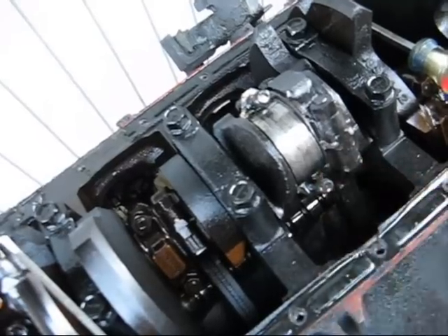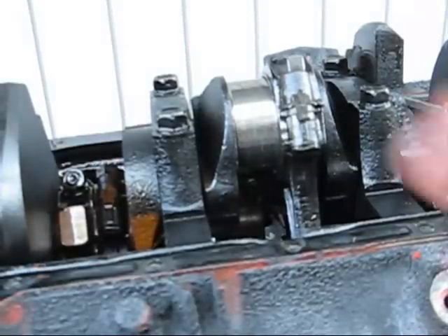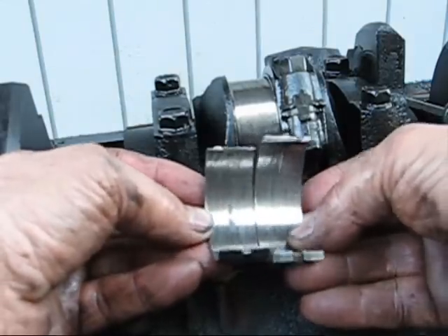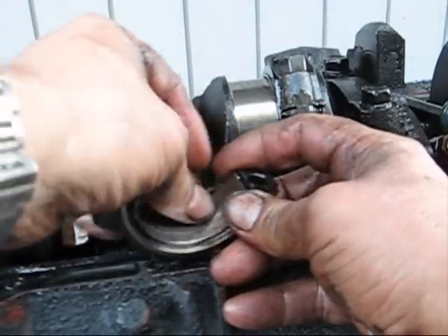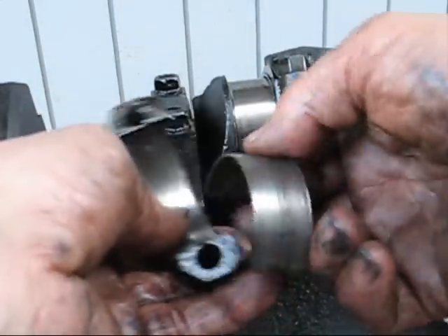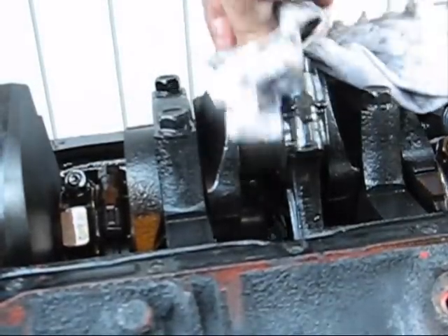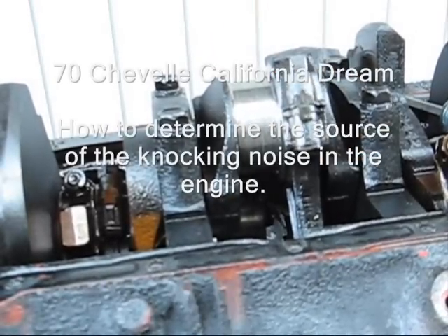Let's take that off a little more and look at the crankshaft. This is exactly what I didn't want to find. See how rough this is — there are no notches here where there should be to stop the bearing. In the cap usually there's a notch and a bearing right there, but you can see that it's just gone. So this bearing has been spinning in here alongside the crankshaft. See the crankshaft, how scored it is. It's awful rough. So, we're going to have to pull the crankshaft.